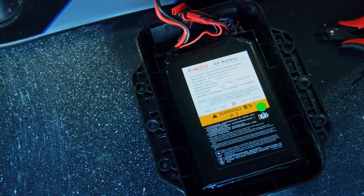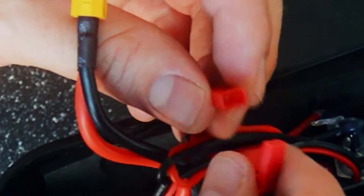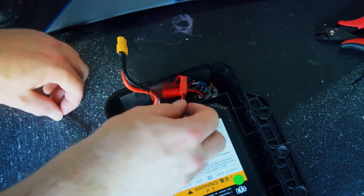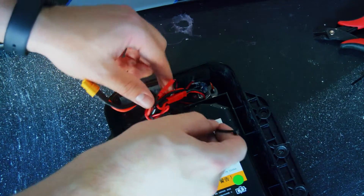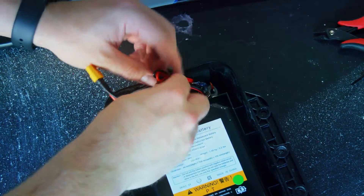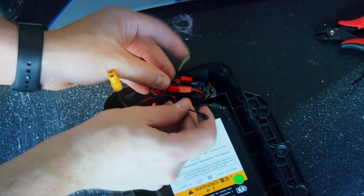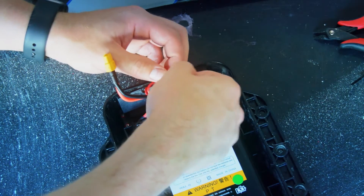You want to make sure the battery is held in there tight so it's not moving around, because you wouldn't want to hit a pothole and break the spot welds on the battery pack. Here I'm reconnecting the USB port and the charge indicator button, and re-securing the cables since there's not a ton of clearance inside this enclosure — especially with the extended range battery in there. You want everything as tightly and neatly packed away as possible.